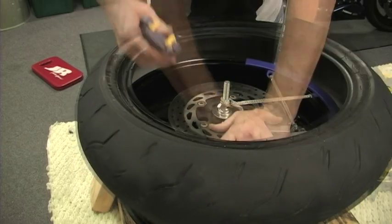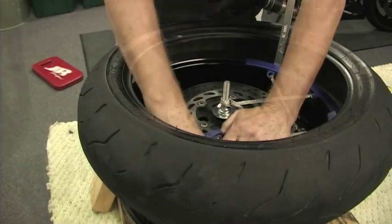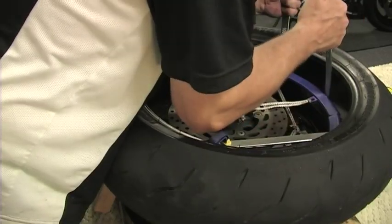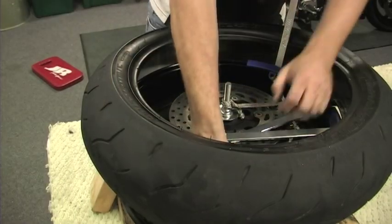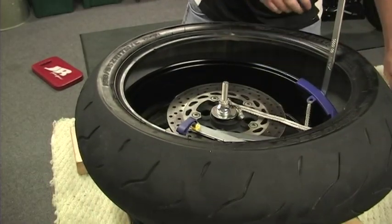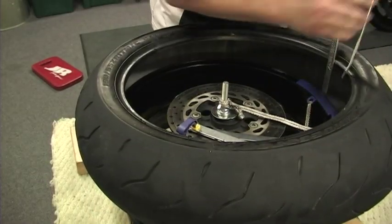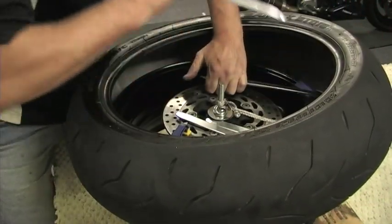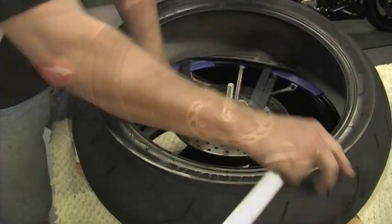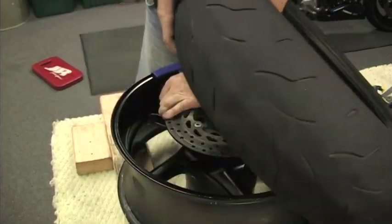This is another one of those steps where it would really be nice to have an extra set of hands around, but I'm going to use a soft clamp to hold the first tire iron in position. The clamp is now used to hold the first 2 irons while I work 2 irons on the first protector, the one nearest the others first, followed by the last to keep the progression of the bead going. Now you can just pull it off.